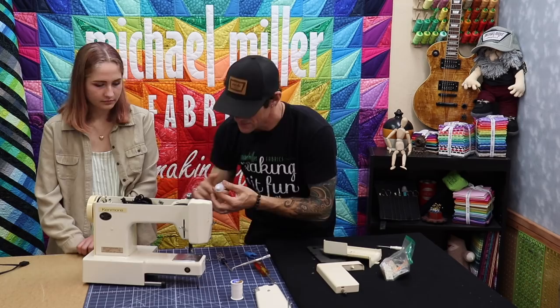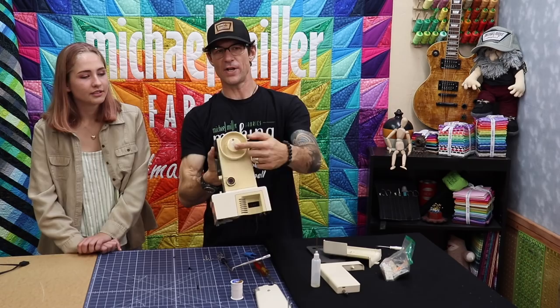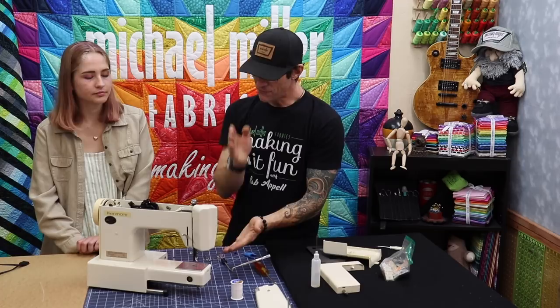Okay, so one of the things I'm going to do now is loosen the clutch over here. Because what does that do? Thank you for asking. Yay! Okay, so the clutch, this part over here on this kind of machine, is used to disengage this upper system. So when you're winding a bobbin, the needle isn't going up and down. The feed dogs are not going back and forth. The only thing that's moving is this flywheel,